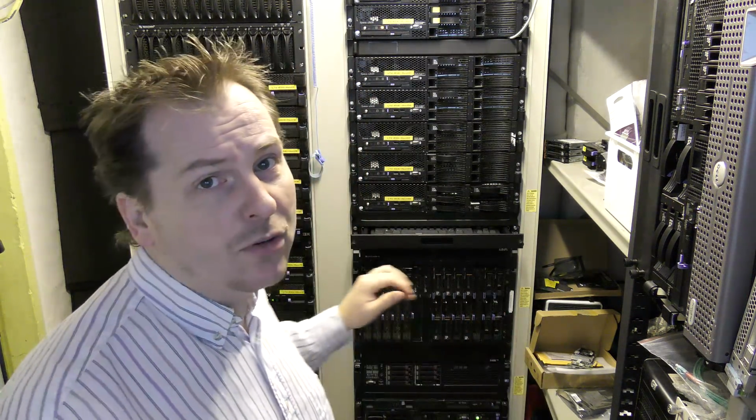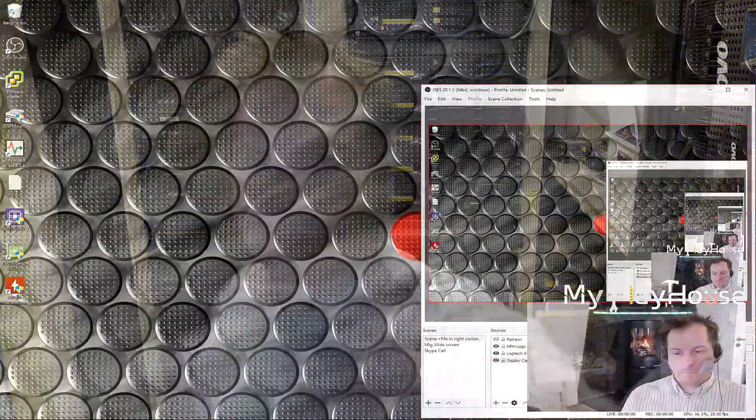So I want to go try and turn that on, and that we do in some configuration files inside of Synology, and we're gonna go do that at the computer. But the idea here is to take those 48 drives. I'll have 4 groups of drives, each with 12 drives in them, and the data will be on 10 drives, and then there will be these 2 drives for security, and I'm hoping that is gonna work out really well. So, but first we have to go and turn it on, so let's go to the computer.